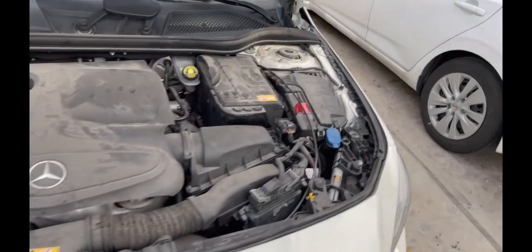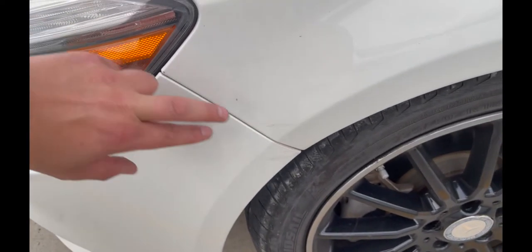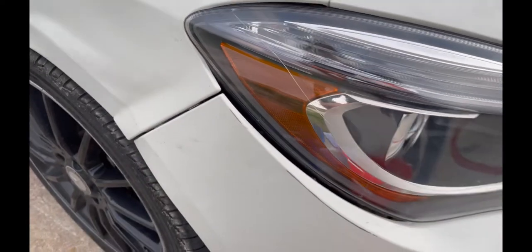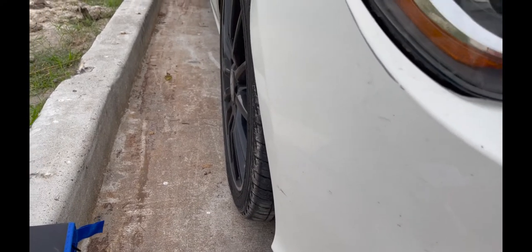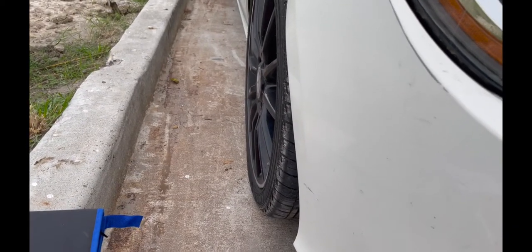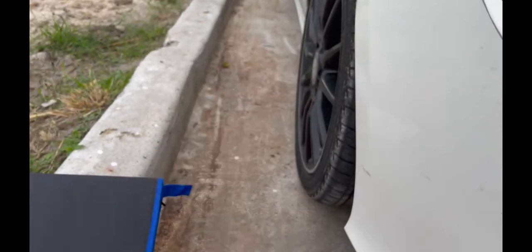Alright, so I'm gonna give you a job overview on this project. It was really windy when I shot this footage so I'm just doing a voiceover. There's gonna be two screws — one there and one there on each side of the car. Both of those screws come in from the bottom, screwed in through the top, and the way we're gonna access them is through the wheel well. We're going to turn our wheels the opposite direction than the side we're gonna do. Make sure to have a universal joint or fitting on hand, along with a large extension and a short extension with a well-functioning ratchet.